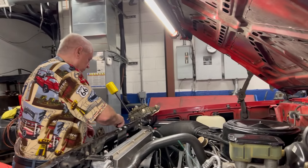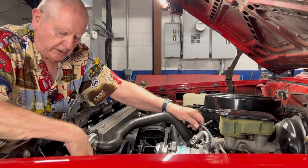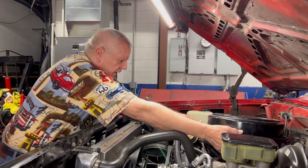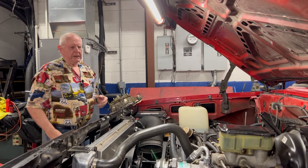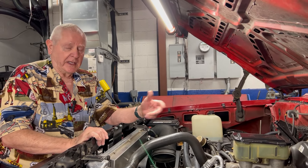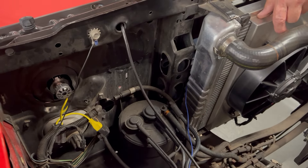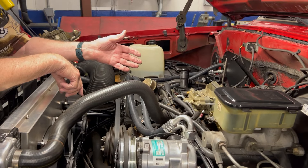Let me get the air cleaner off here. Now you might look at some of this stuff as I'm unplugging it — this is a hose that goes to a charcoal canister down here. Back in the day that was a way that the gas tank vented fumes, and then eventually emptied that container and burned it back through the engine. All these lines that hook up in there are related to that. There is a purge valve right in here that actually opens and lets the fumes out that it's absorbed from your gas tank, and they go up through this line and are sucked into the carburetor and burned as the engine runs.